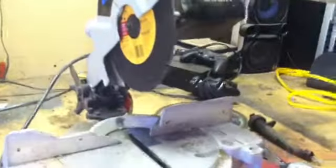I put a blade in it and when it spins it's a little wobbly, but after you get to speed it's sort of accurate — your cut isn't perfectly straight, but it's better than freehanding it. So I just notched it so it could fit really nice in my piece right there. Look at that — seamless. It's pretty good. That's why I bought it. Because if you just weld it straight like that, you have two gaps on each side and you're just filling it with weld, and that's never strong.